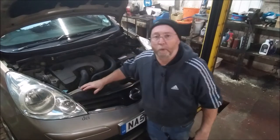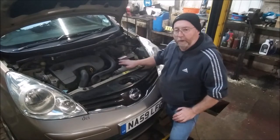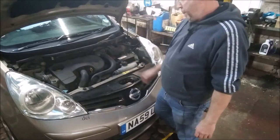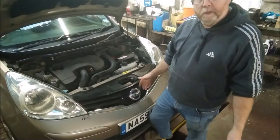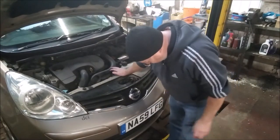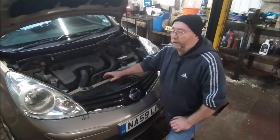We'll move on to the water — the cooling system now. It's a good idea before you start doing anything with your cooling system to check for leaks — radiator, hoses, things like that. But on modern cars you can't see much at all, even for a professional. So a new motorist has got no chance. If yours is different and you can have a look for leaks, try to do so, because anti-freeze can make a slight leak worse — anti-freeze finds the leaks in your cooling system.